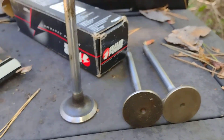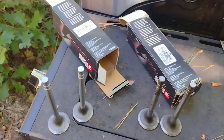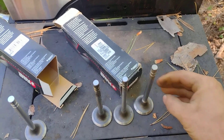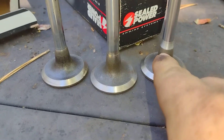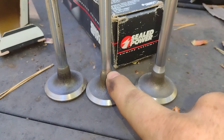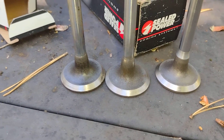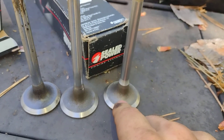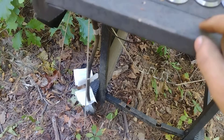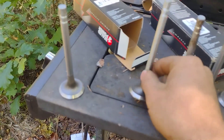I think I found a website that finally makes them, and I'm hoping it's not the Brazil one because it looks a little off. You notice they're machined slightly differently too — these two match each other, but compared to this one from Brazil, you can see how much thicker the margin is. That's probably why — different material, machined slightly differently. It's a 1904 but these Mexico ones are machined very close to matching the original. Everything's the same from the stem down, it's just the face.